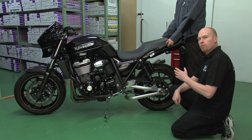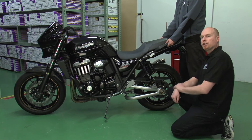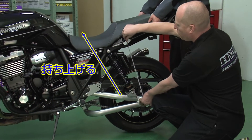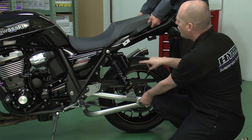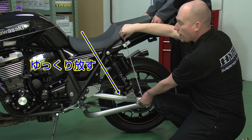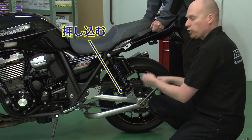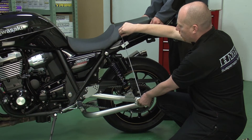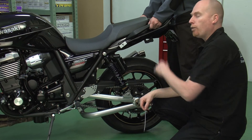After that I can use this marking point to check the reference length and measure the static sag. We start with measuring the reference — somebody lifts the bike up and we measure from center axle to the reference point. This is measurement one. Then we let the bike sag to measure sag high — the second measuring point. Then we push the bike down and release very slowly, taking care of the friction, and measure the last point — measurement number three.